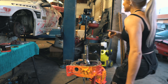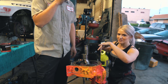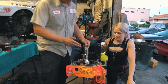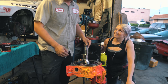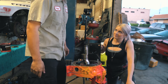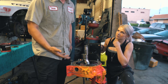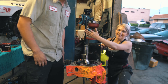Can you explain why the RX-8 rotating assembly is better? It's kind of a mixture of different things for this block — it's turbo 2 but it has NA rotors and RX-8 shafts. The reason we're using an RX-8 shaft is because it's two pounds lighter, so this will give her a quick whiplash-type rev effect. Two pounds lighter in a rotating sense actually helps it rev up a lot faster — kind of like a lightweight flywheel. It just fits like the normal one for turbo 2, straight drop. NA rotors, high compression, so you can make a lot more torque for drifting — you just want that usable power band. And that's your quick facts with DK at Garage Life.